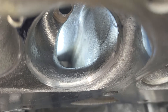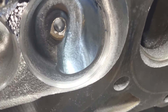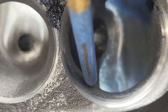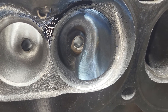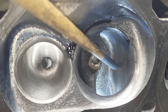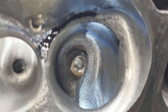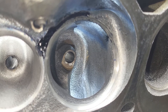That short side has been brought over to the right a little bit, and it's been brought over to the left quite a bit. If you look straight down you can see how much it's been moved — it has a lot more area now to get air around this way, which of course bangs right into our air that's going up the high helix ramp. It'll be a turbulent charge, no doubt. Will it make power? We'll find out. My next job is to take this down — I'm expecting to break right through it because I need some area here. See how that gets squished down? I'm going to open that up. It's going to be a high RPM mill, so if it's open to that bolt hole, it don't make a damn bit of difference. And this is the junk head, so might as well see if it likes it.